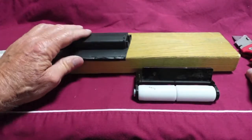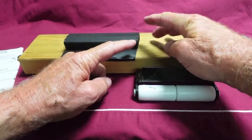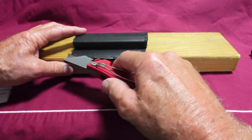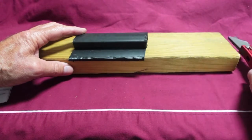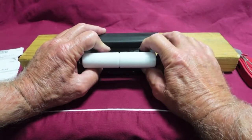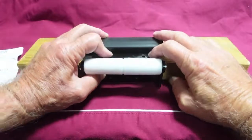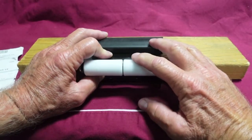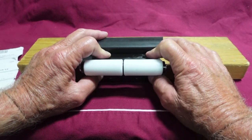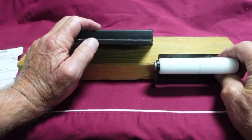Not too terrible. But according to the instructions, they just want you to eliminate the seal. It comes up here. I'll show you the seal out here in just a second. You'll take your box cutter and carefully remove that seal. Don't go no wider than you have to. And you're to lay him on top and hold him in and down and apply your 5 screws like that. So that clearly should put the rollers just a little more than a 1/16 inch higher than the wear bar. But I think in the end, when you get everything tightened down and the weight settles, the more your wear bar is wore down, then it will apply to you even more so.